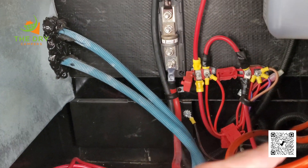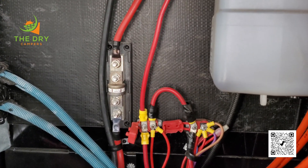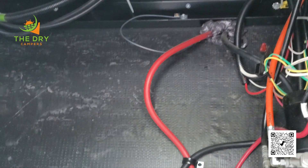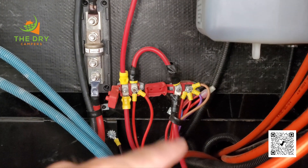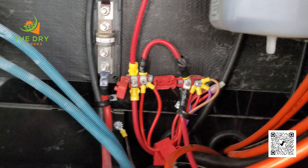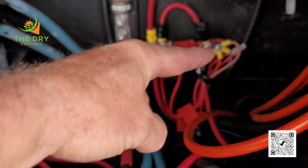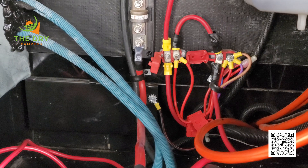It's coming out. I have to do some reworking in all of this. It has a residential fridge and we'll be removing all of that, along with the switch, the positive and negative going up there — taking all that out. Revisiting all of this because it just doesn't look spread out enough. There should be more fuses and circuit breakers — you shouldn't have like four things on a single post, and then off this post you have two additional 30-amp breaker fuses.